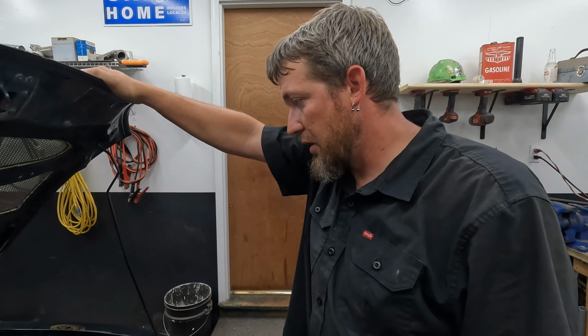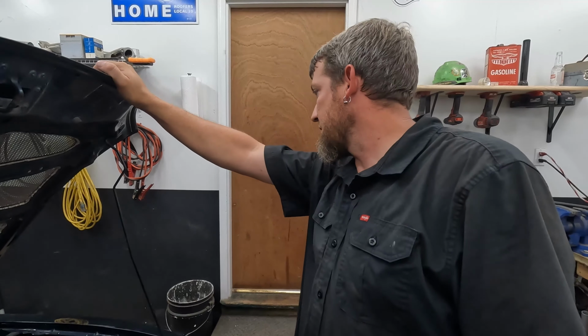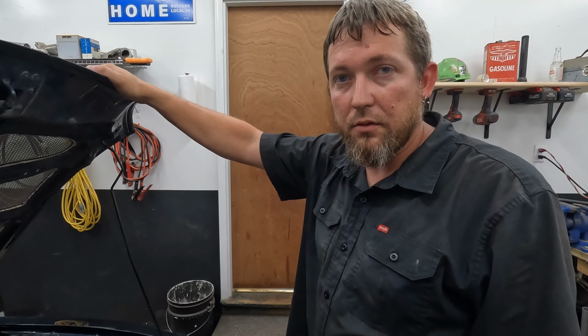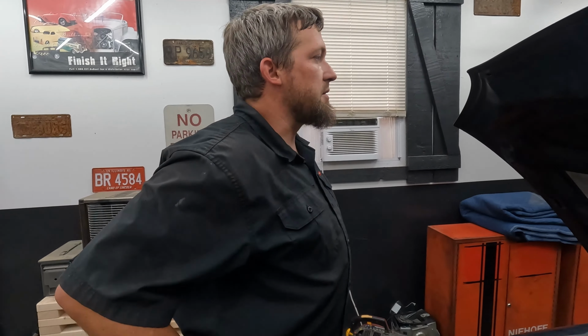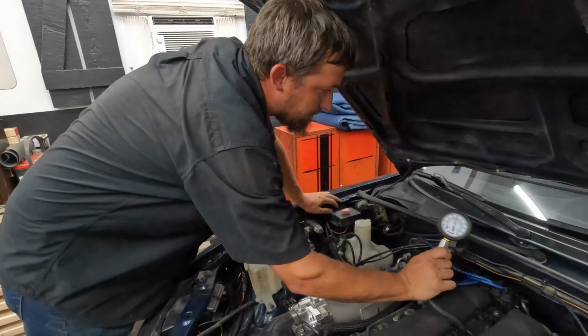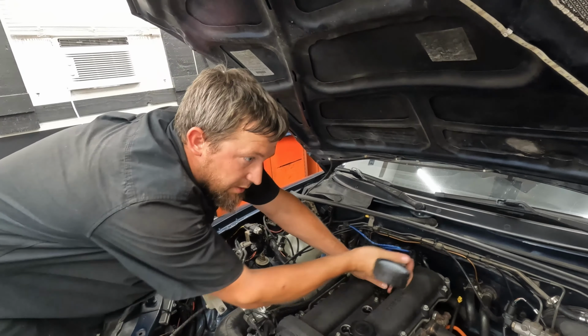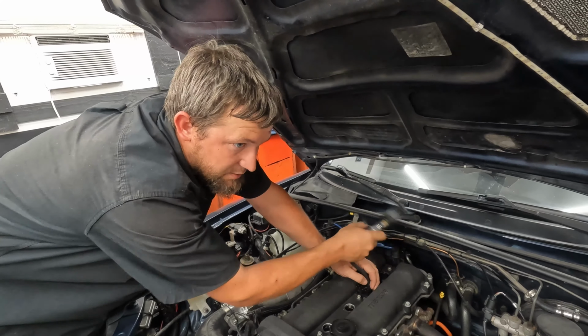So, I'm gonna check one more thing real quick. I'm gonna make sure it's not the battery being low. Well, I made sure it wasn't the battery dying because it was starting to slow down a little bit. I mean, plugging it in, it went back up a little bit, but my original reading was 150 and it's, you know, 145-ish. So yeah, definitely down a cylinder. Like I said, if you put oil in it and it doesn't go up, then it's not your rings.